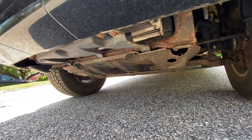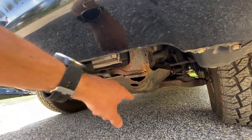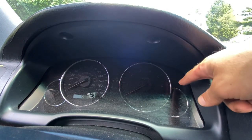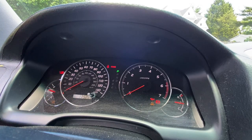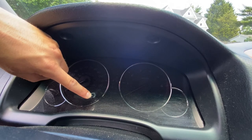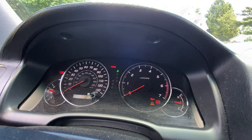Skid plate is back on. Just remember that the oil filter is right up there, so if you want to check for leaks in the next week or so like I usually do after changing my oil, I always like to look up there and check for any leaks around that area. Now one of the last things you want to do is reset your maintenance required light — it's on this side of the dash. Turn on the key without starting the engine. While you have it on the odometer setting, make sure your key is completely off. Press down on the little odometer trip reset button and then turn the key but don't actually start the engine. Continue to hold the button — you'll see that the light is blinking rapidly. It'll go on and turn off, and just like that you've reset the light.